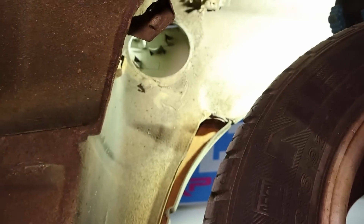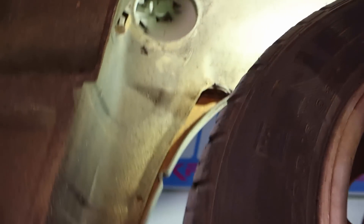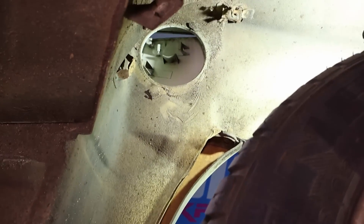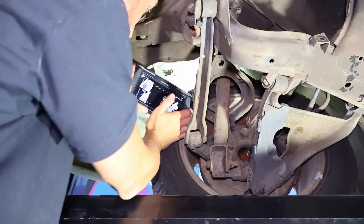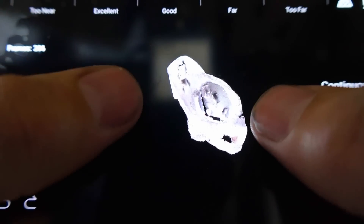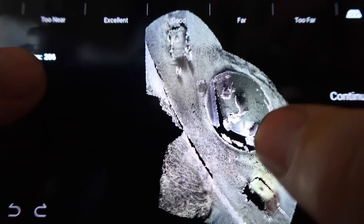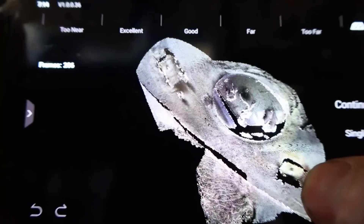We are at the back of the Nissan and what I'm looking at here is the gas tank flap fill port. We're going to reuse that for the charge port. I'm just going to do a quick scan and try to reuse one mounting point right there and one right there to make a new bracket. Here's the scan — we did color on this one, which I think will allow us to get a pretty good design for a bracket. Let's get this into CAD.